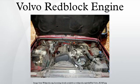The B19 engine has the same stroke as all other Red Block engines; the smaller displacement is the result of a smaller bore. It is a very robust engine with forged pistons. The B19 later turned into the B200 low-friction engine. The B23 ET and B23 FT motors were offered for two years only, in the 1983 and 1984 Volvo 700 series.